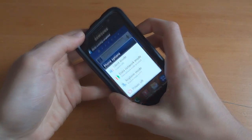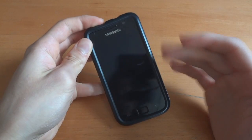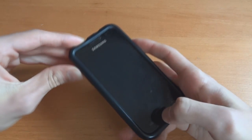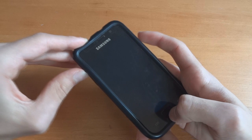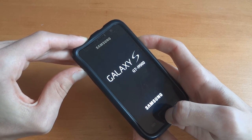So now we're going to go into recovery. I'm going to power off the phone. If you've got extended power menu then just go straight into recovery, that's fine. But as I said I'm on stock, but I've got a kernel which is Clockwork compatible, so in other words I can access Clockwork recovery.